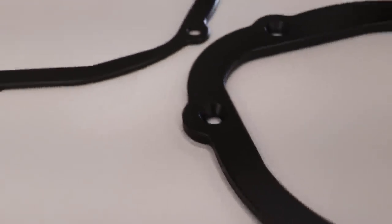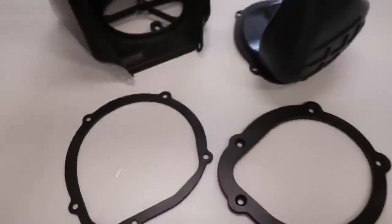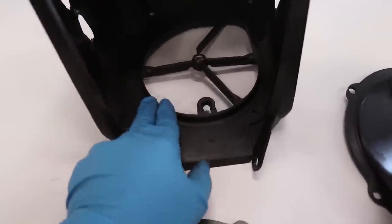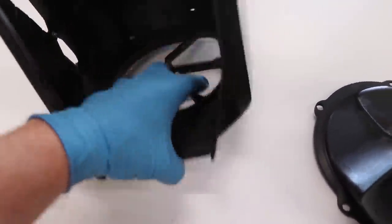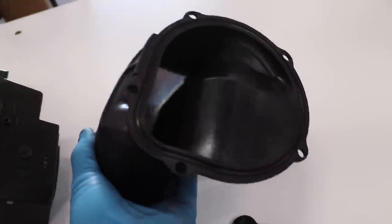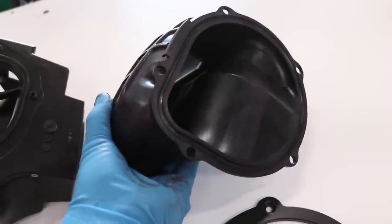The plates are looking good, all done with Cerakoting, and now we can slap this whole kit together. So we're gonna put sealant on the inner lip of the airbox here, as well as this lip around the outside. And then sealant's gonna go on this side of the ring too, as well as the inner lip of the air boot.